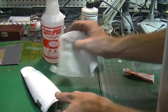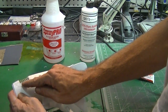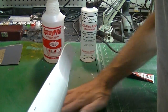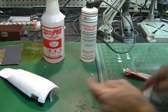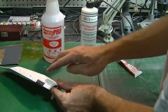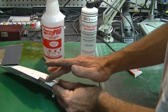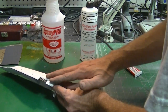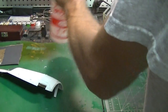I can see there are a couple of little small areas — just a couple little indents still in there, a couple little imperfections. So what I'm going to do is dry this a little bit with my heat gun and come back in and put some of that red spot putty on there very thinly. That'll take care of the final imperfections. We'll sand that out and then final sand this with 600, and we'll be ready to prime this and have it ready for paint.